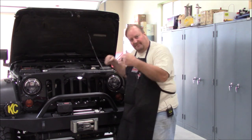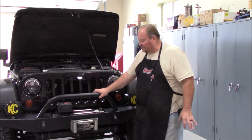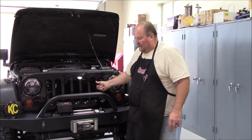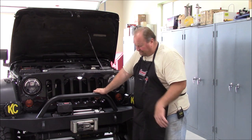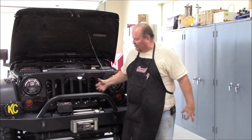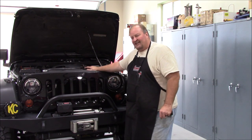You really want to sink your winches down properly between the frame rails. Even my control box here is right at the bottom of my grille openings, so it's not obstructing any airflow. The stinger bar is two inches — yes, it takes away a little bit, and as the air comes in it creates a low pressure diversion. Ideally I'm probably going to cut the stinger bar off at some point. But say you've got a Power Plant right here, leaving five inches above, and you put a light bar or big KC gravity lights on top — you have hardly any natural path for airflow through that cooling stack. So you're relying on that fan to do the majority of the work. You want that fan to work as little as possible.